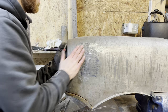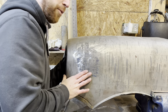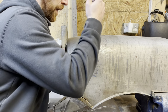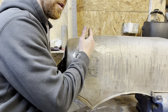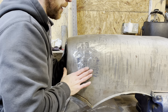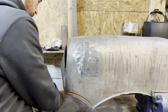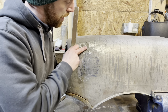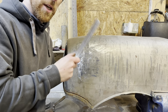Upon checking, it's a little bit high here, so now this requires off-dolly technique. We're still going to apply pressure with the dolly from behind and hit that area, but with the dolly slightly offset — because directly underneath would cause a stretching or lifting effect, and we want the reverse: we want this material to go down. I'll go for the heel dolly and a slightly lighter file slapper. My dolly is here and I'm just going to hit this area. We don't want to hit it too hard so it sinks right in — just gradually tap it down.